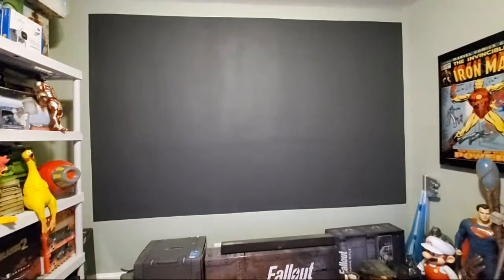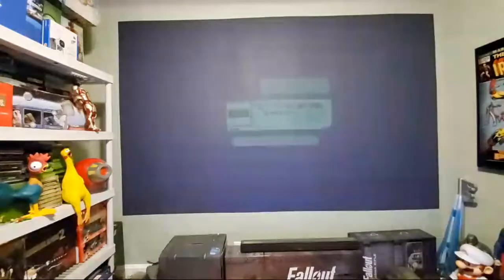So turn my projector on. And don't freak out when you get this projector if you do happen to buy it, because when the indicator comes on, it's red. Some people think when red comes on, it means your light may be damaged. No, you have a light there that shows the status of your lamp. If that's blinking red, then it means it's time to change your bulb. The lamp life on this projector is around 91, and when it reaches 100, it'll be depleted, which I'm not worried about because it cost me $44 to replace the lamp, which I already did. Let's see what we got hooked up.